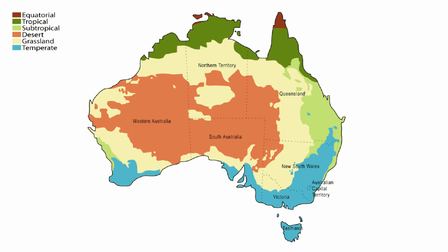A cooler intercooler is great, but I probably wouldn't have bothered if the effect wouldn't also be shared by the radiator. I think I'll find myself using this more often to cool down the engine than I will to improve performance. Spraying water on something to cool it down takes advantage of the evaporative cooling effect, and one thing to know about that is its effectiveness is less dependent on the ambient air temperature and more on the ambient humidity. When the air is dry, it's extremely effective, and when the air is humid, it has almost no effect at all. So it's a good thing that I don't do most of my driving in a subtropical region. No, wait, that's exactly what I do.